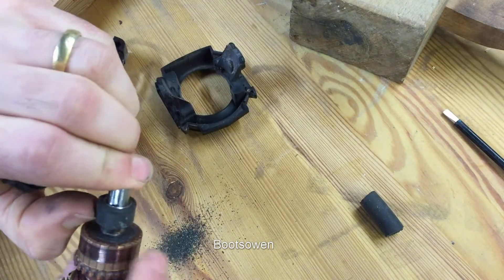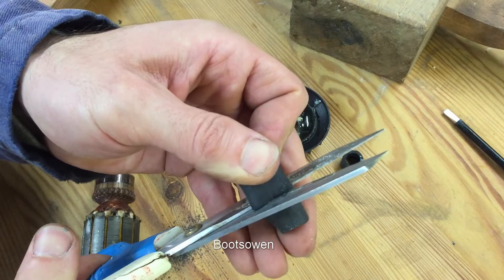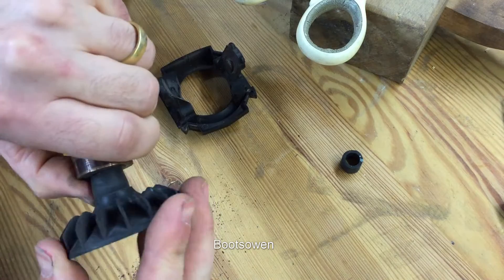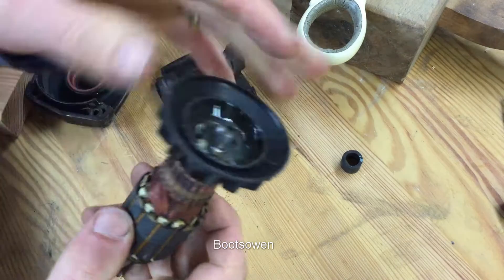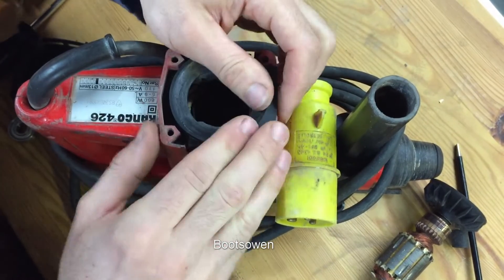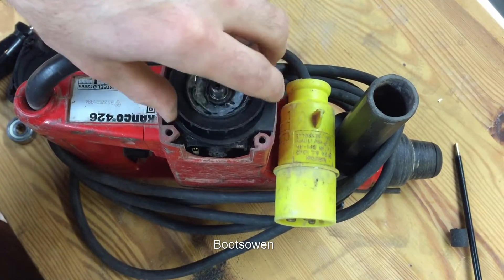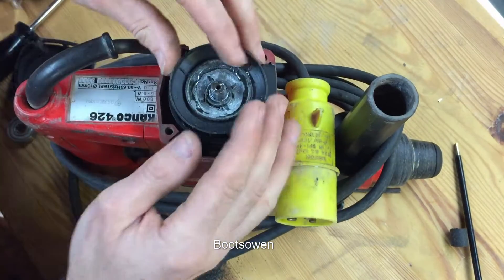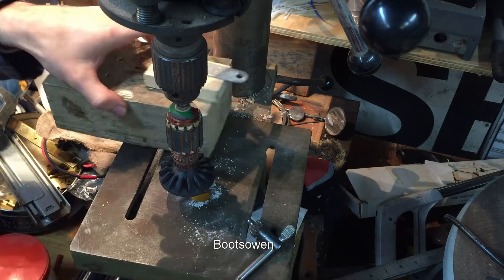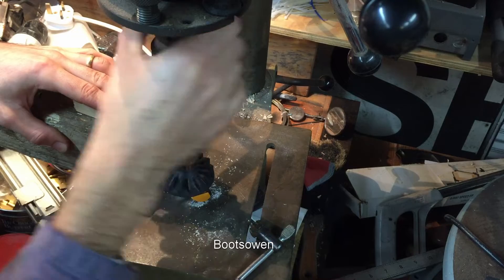It's starting to slip down a bit. Because it's rubber I could just put a longer piece of rubber on it to stop it slipping down. Just rotate it around rather than forcing it — it just friction fits on. Now it's not perfectly aligned, but give it a go like that. This is the thing that holds the brushes. This has to engage with its gears down below, and that's how the fan works — the fan catches the air. This is my own extremely crude dial gauge mechanism — I've got the armature chucked into the drill press with some blocks of wood and a little piece of metal, just rotating the chuck by hand to check it's running evenly.